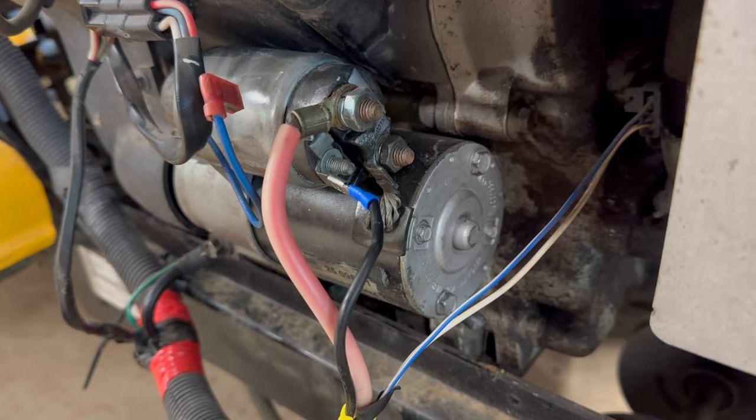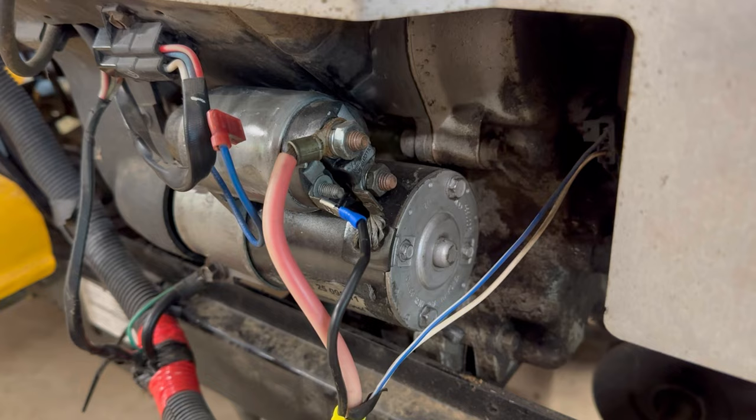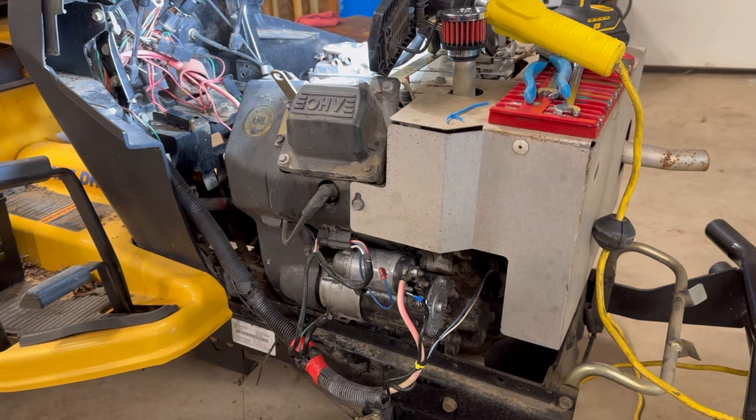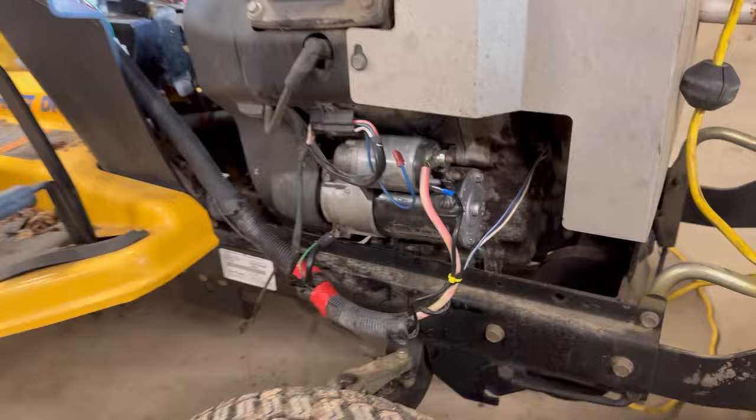The key to bypassing everything is to find out how to wire directly from our trigger wire all the way to the switch — that's today's lesson. Now I know a lot of you are looking at this saying it doesn't look like anything on your lawnmower — that's because this is a shaft-driven Cub Cadet from probably 1999. So I'm going to run up to Mower Mike's junkyard and show you some more typical starter solenoids on lawnmowers, just so you know what you're looking at, because typically they don't have these giant car starters on them.